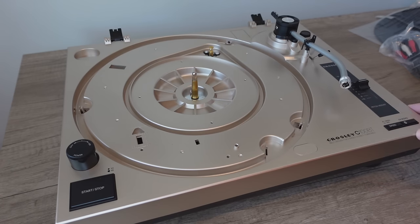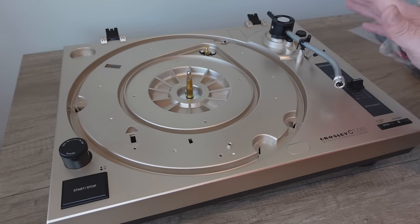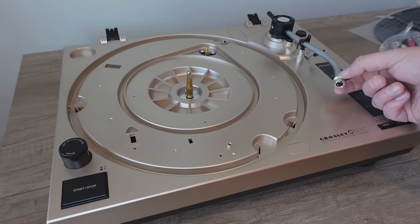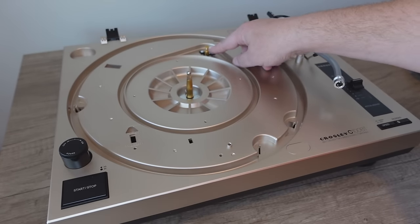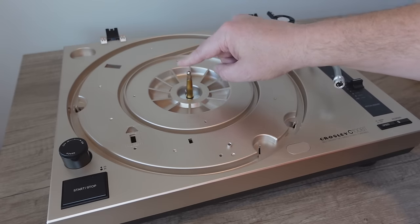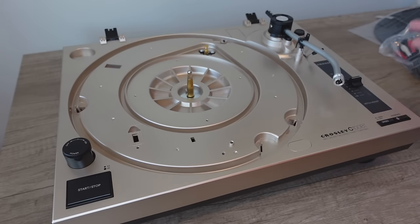It comes out of the same factory but they leave it without that extra weight. People will talk about whether or not that really adds to the sound quality. But this is a fantastic, fully manual turntable. It's got an S-shaped tone arm and a standard half-inch mount head shell assembly. It does have the pitch control, it is two speeds, and this one does Bluetooth out, so we'll take a look at that as well. It's got a voltage switch and it is belt drive, with the brass motor pulley and the main spindle bearing. There's also a direct drive version if you want that extra torque, but this is perfect for most people and it's a heck of a good deal. I smile when I see it — it's just a great turntable. Nobody has anything bad to say about this who's had one.